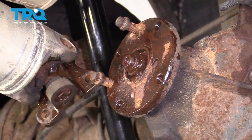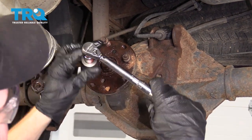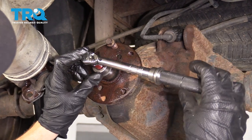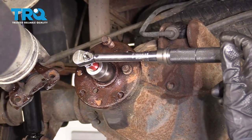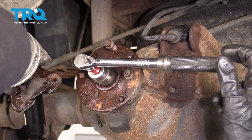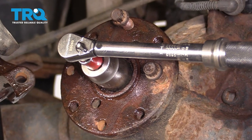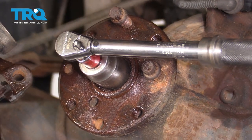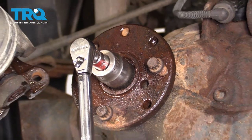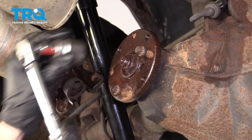Spray down this pinion nut. The next thing we want to do is measure the rotational torque — essentially how much torque it takes to spin this. I'm just going to take my inch-pound torque wrench, put it on there, and essentially all I want to do is make it so right as soon as I can feel that it wants to click, it also starts to move this pinion. I don't want it to click with nothing happening, and I definitely don't want it to spin freely before it's ready to click. Once you have that specific measurement figured out, go ahead and write it down because you're going to need it later.